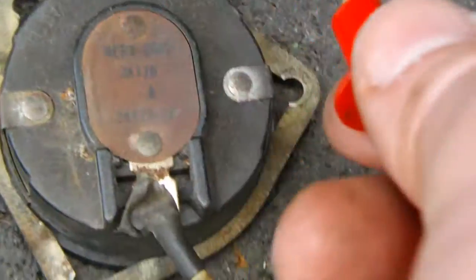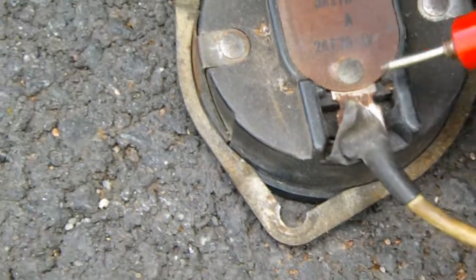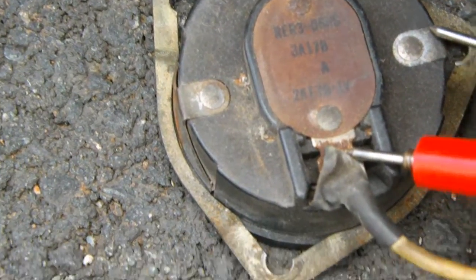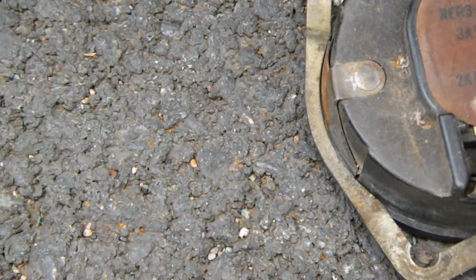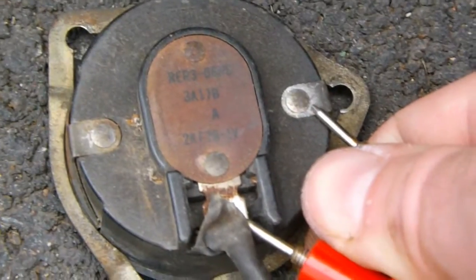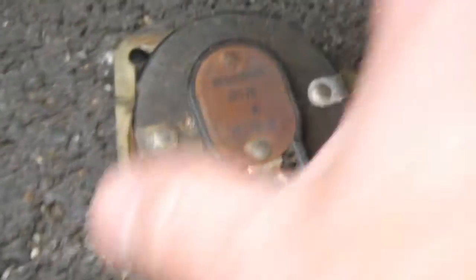This is one I have — I don't even know what kind of carburetor this came off of. It's slightly different, but I think she'll work — it's just for a derby carburetor anyway. And when I test that one, that one is showing 7.6 ohms, so that one should work. This one's slightly different than the ones I had — I don't know if this is an aftermarket one or what. It has a little bit of a different spring, but I just had to get that lined up and we'll give her a shot and see how that works for us.